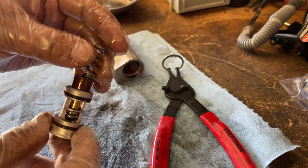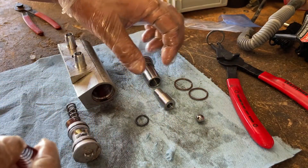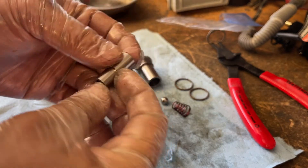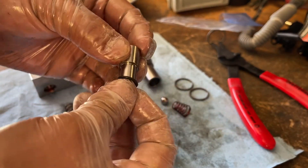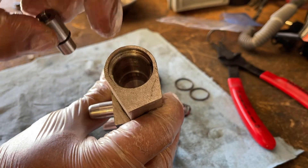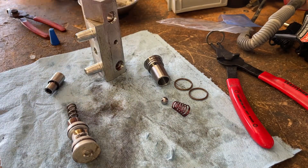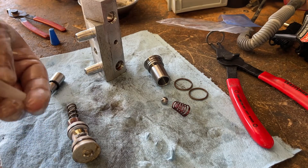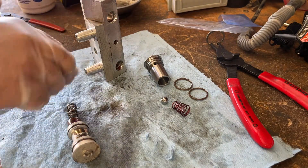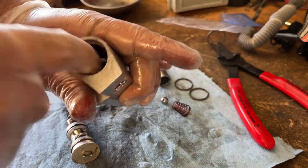You can see how they have this going back together — it's a simple thermostat, very similar to a normal coolant thermostat. They give us all the parts we need in order to do this job, and there is a certain way everything has to go back together. You're going to grab the bushing, put the new small O-ring on right here, then check the block that's going to sit right on top. For this I'm just going to use some Lucas — not a whole lot. Lucas works as an awesome assembly fluid; you don't need much.